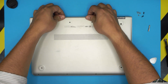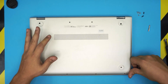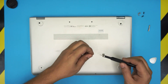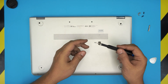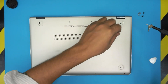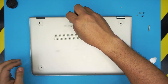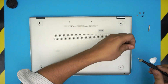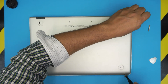Now grab the bottom cover, sit it down straight, and press it down. If you see any gaps, just pinch them between the top and the bottom cover. Finally, put the bottom screws back in — the two black screws go right under the hinge under the rubber legs, and the silver ones go wherever you find a screw hole. I hope this video helped you with your upgrade. If it did, please hit the like button. If you have any questions or requests, leave them in the comments and I'll answer as soon as I can. Thanks for watching, and I'll see you in the next video.